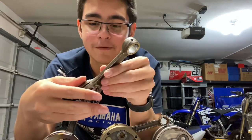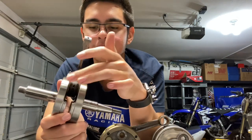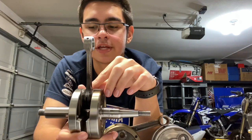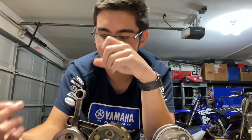Quick recap: our connecting rod, our crank pin, our two crankshaft webs, our big end bearing, a small end bearing which you'd replace when doing a top end, and our two thrust washers. They're really pretty simple assemblies once you break them down. Essentially what happens in your motor: when your piston comes around — boom, explosion — it shoves this down and then goes back up. In a two-stroke the explosion happens every time the piston goes to the top.